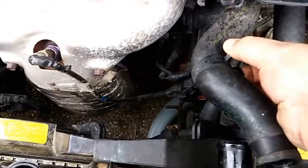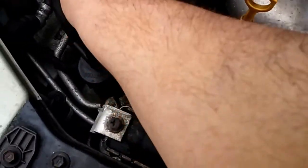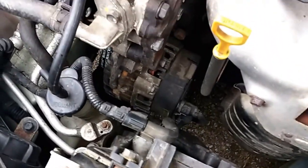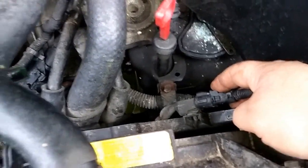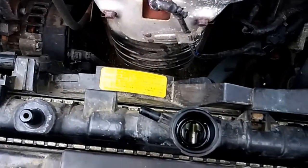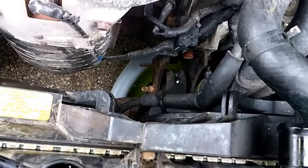I've taken the top radiator hose off — that's sitting to the side, and the coolant is drained. I've taken this overflow hose that went right here — that's off — and it also connects into the fan shroud right here. It runs through there; you have to kind of pull it out of there pretty hard and it comes out. Now I'm going to go ahead and take the coolant fans off. There are electrical connectors here and here, a bolt in the middle that goes through both fans, and then a bolt here. It looks like they just slide down into a bracket at the bottom, so they should pull up and come out. I may also have to deal with these little nylon zip ties holding some of this together — they do come off with a little tab you can squeeze to release them; you don't have to cut them.